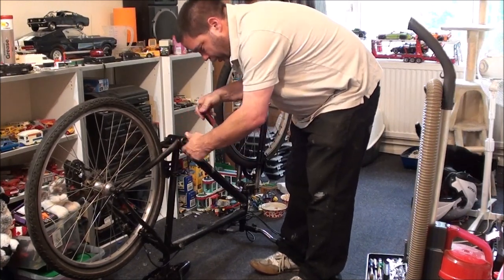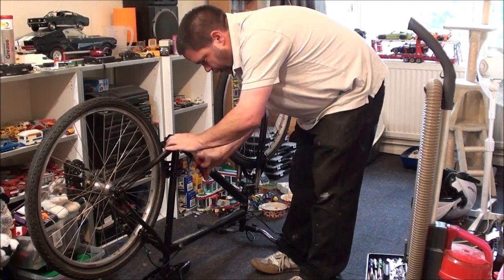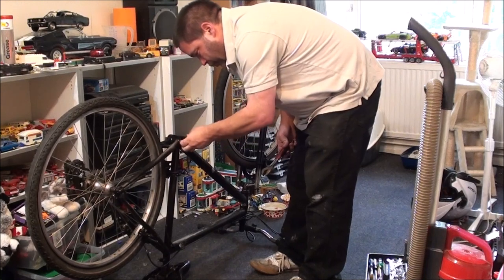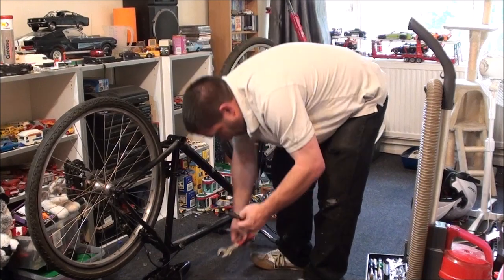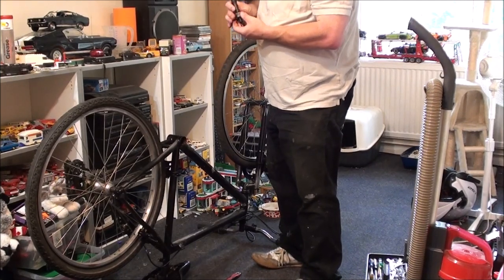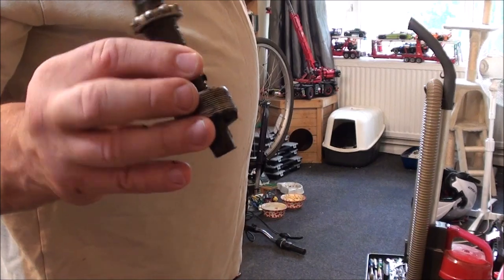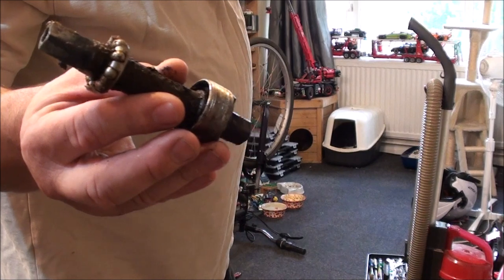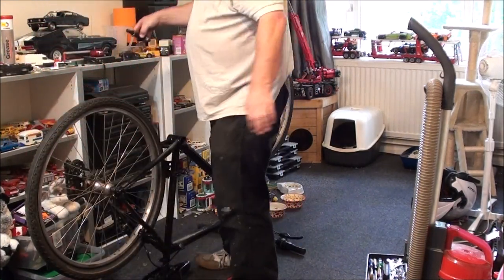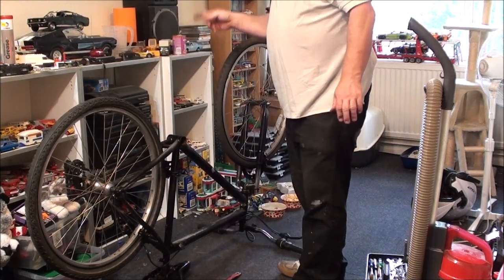This one's unscrewed — it will not unscrew on the other bike I've got. Bearings could actually be fine. Maybe they took all of this off for painting — maybe I'm wrong. I'd rather take it apart now and check it and find it's totally naff. I have got a wrench for the other side, but normally you don't have to worry about that unless you're changing the whole style of your bottom bracket. This one uses caged bearings. You can get sealed bottom brackets and semi-sealed bottom brackets, which is basically where one side's sealed and one side isn't. Bearings are actually okay — they are just full of crap though. I may replace those. They're not expensive to buy. Now that I've got it apart, a few quid for a new set wouldn't be a bad thing — which is kind of going against what I said earlier about not putting any brand new parts on this, but sometimes you've got to make an exception.